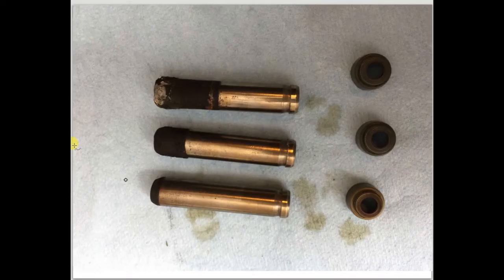There are three valve guides that have been removed. The bottom valve guide is what you'd normally expect — this is in the correct position and has not slipped or dropped out of place. In the middle is a guide that's dropped out a little bit. Notice how much more of the guide is covered in carbon — it slid down a little bit and actually popped the valve stem seal off.